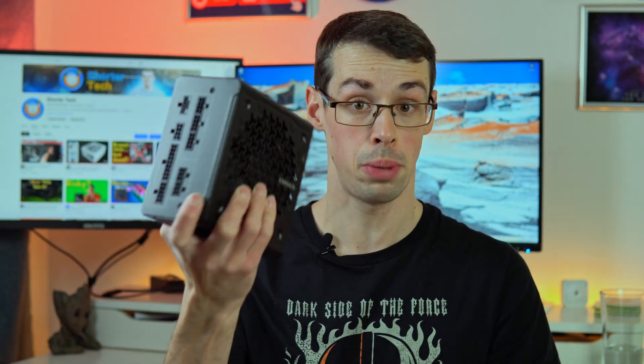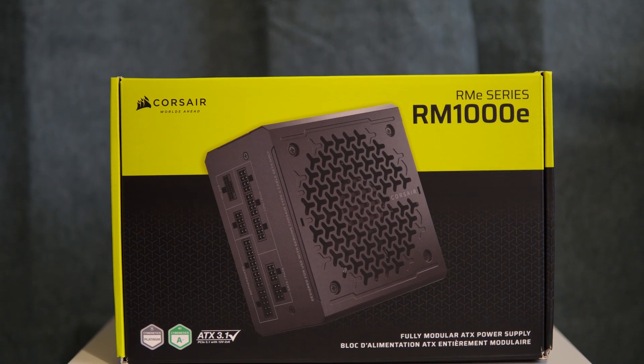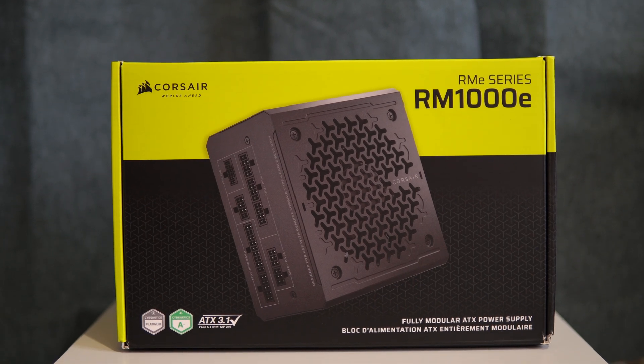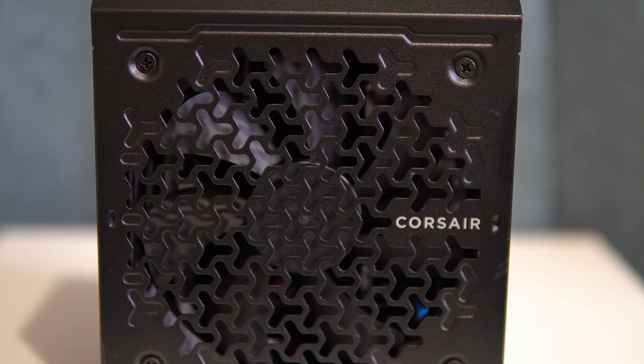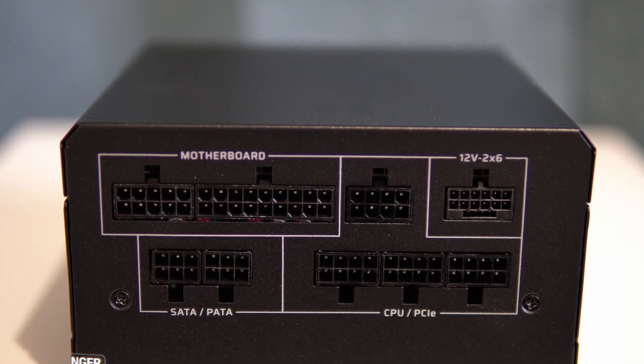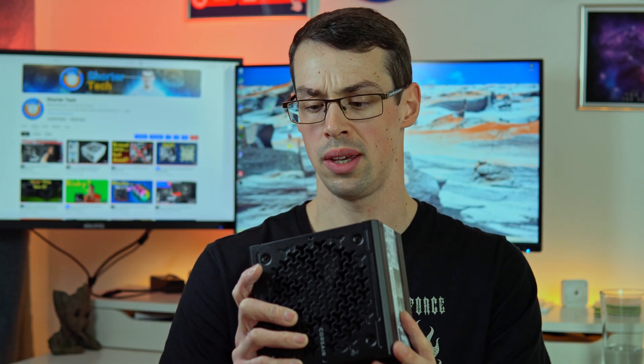So in that case, where you have really powerful hardware and you want to explore overclocking, your other option is to go out and buy a new PSU and make sure it is overpowered. I'd err on the side of caution and go one step up. So if your graphics card says you need 750 watts, I'd probably go out and buy an 850 watt or a 1000 watt power supply unit, because at least you know you've got that extra headroom in the future if you do change your graphics card or something like that. In my opinion, that's just worth it.